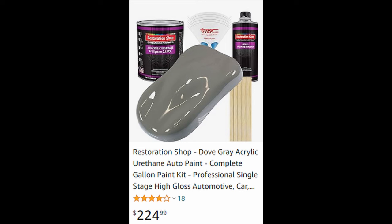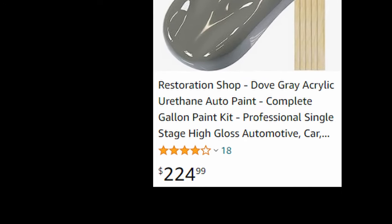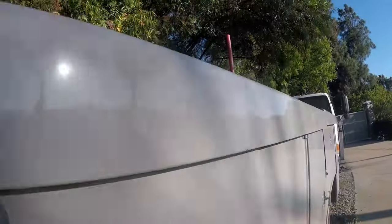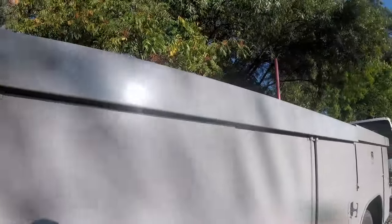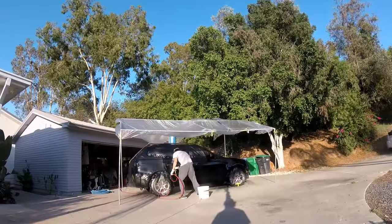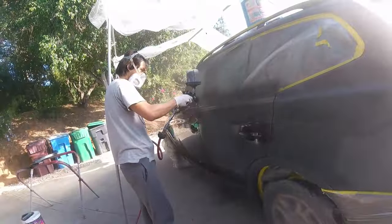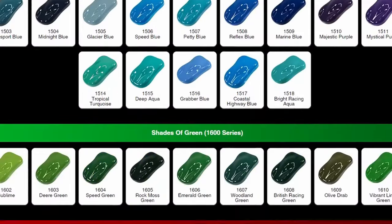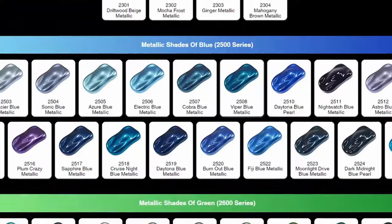The best option in this bunch is the acrylic urethane. A gallon kit of acrylic urethane is $225 — again, that includes the paint and the hardener. The difference between acrylic enamel and acrylic urethane is only $36, so at that small a difference, I'm not sure what place there is for acrylic enamel, because it performed so poorly. Although the acrylic urethane has held up really well — much better than I expected for a budget paint job — I don't necessarily endorse it for your automotive paint job unless you're going for something cheap and don't care about matching colors, because there's no color matching to a specific OEM color code. You just have to pick one of their pre-mixed colors.